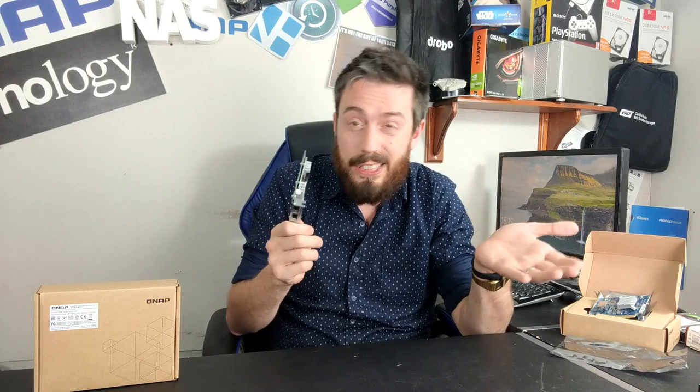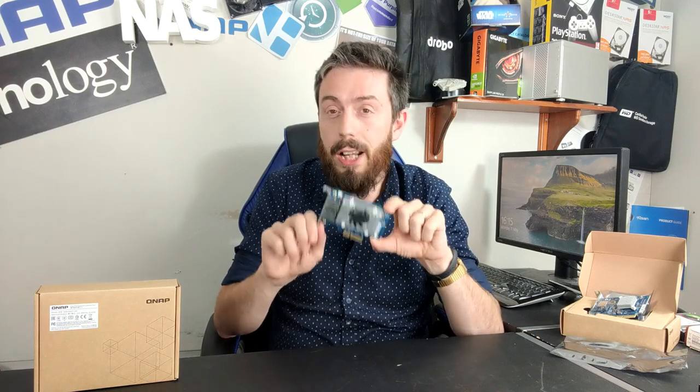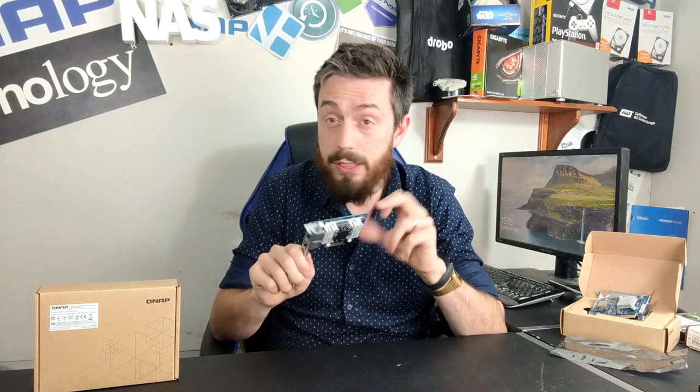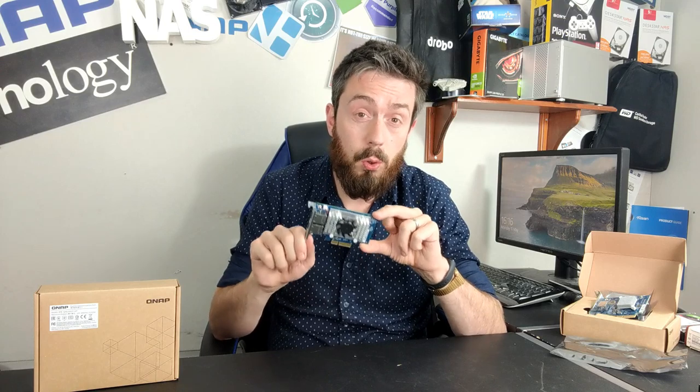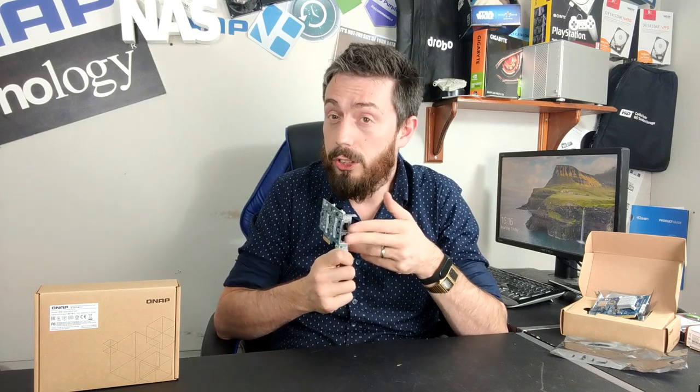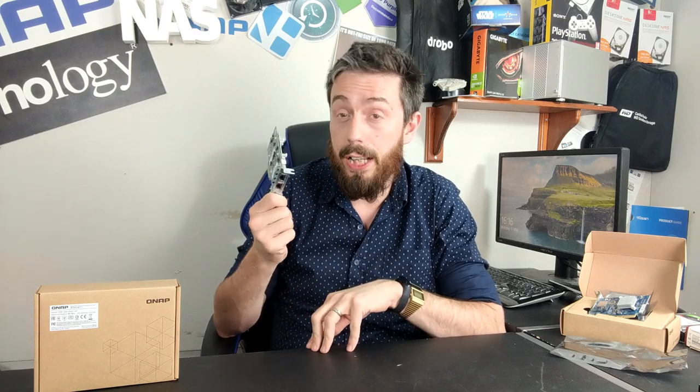This card arrives at around £160 — give or take £165 to £170 including tax. It not only opens the door to 10GbE but also to link aggregation, ultimately 20GbE. It targets devices — a PC, Mac, or Windows system — arriving with a PCIe Gen 2 x4 slot, which most modern NAS devices have these days. However, for true link aggregation you need a decent CPU; standard Celerons probably won't get anywhere close to the maximum 2,000 MB/s this card can potentially deliver.